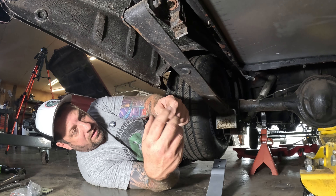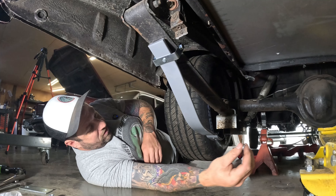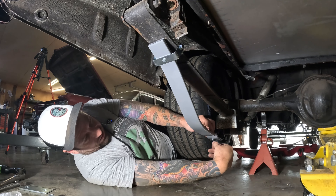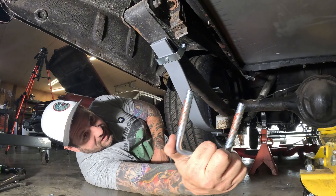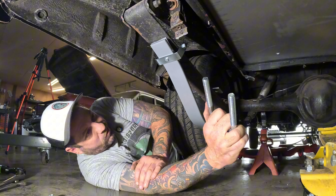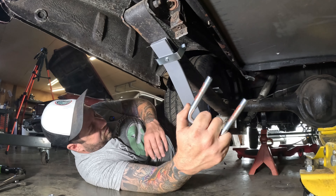We're just going to throw this up there and hang it in place. Here's your little rivet — you place it in the hole. We're going to put it in the hole that provides the most lift, which is the further one back. At this point we can hang this in with our U-bolt. I put a little bit of anti-seize on this. Anytime you're using stainless or chrome-plated hardware, it tends to gall, so anti-seize helps a lot on that front.